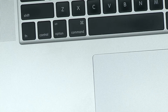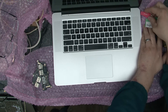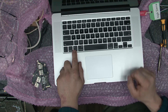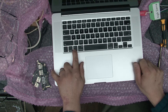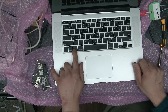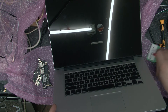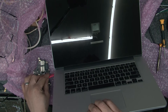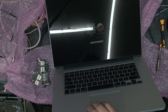This machine is password protected by its owner. We know that the USB on the right didn't work. So what I'm going to do is put a HiSierra installer in there, press and hold the option key, and press the power. Now what I expect to happen is it to go into the picker mode. And when we look at the picker now, we can see we've got the option to install HiSierra. If I take the stick out, the option goes away. I'll put the stick in the other side - and there it goes. So both the USBs are working on this machine.